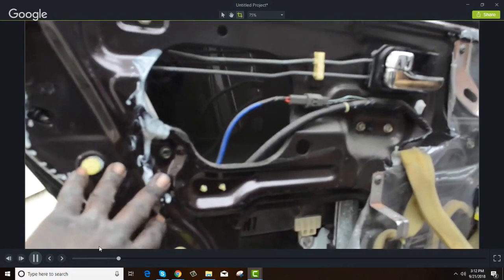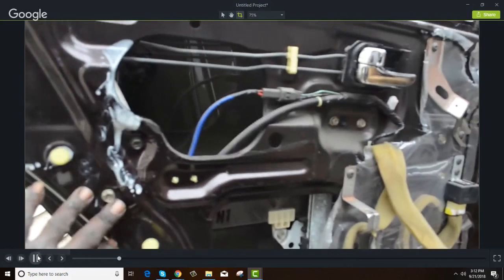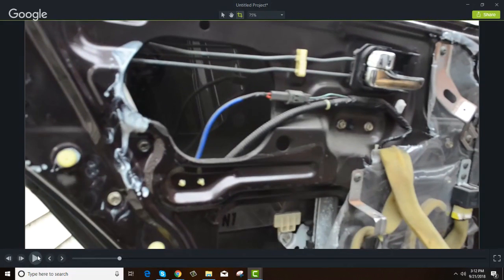You're going to have to get the door panel off the door that will not open. In most cases you cannot get the door panel off, so you will at least need to pry the top of the door panel up and out to where you can reach a stiff rod with a hook in it to be able to operate the mechanism up and down while spraying lube in there.